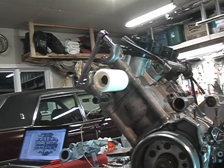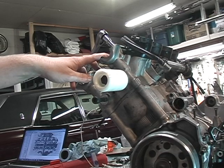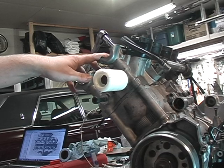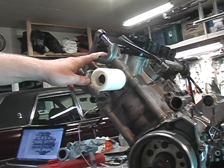I'd also like to note that there are washers underneath these special bolts. I wasn't aware of that the first time around — all my washers stayed inside the cylinder head. When I slid the cylinder head on, I saw them get pushed up slightly by the rods, because they caught on the threads. So I seated them back down with a pick. Be aware that they're supposed to be there.